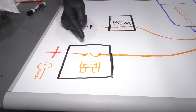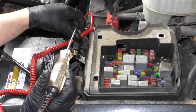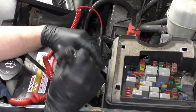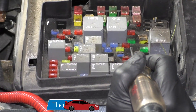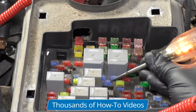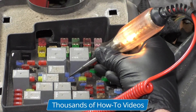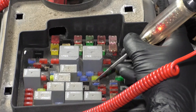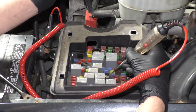The first thing we want to check is the fuse. You want to have the key in the on position — you don't have to have the vehicle running, just in the on position. I have my test light on the negative lead. Just double check your test light, make sure it's good, it lights up. For this vehicle, we have two O2 sensor fuses. We have one right here — O2 sensor 1 or A — check both sides of the fuse, and that works good. And then O2 sensor B is right here, and those are both good. It's good to check both of them either way.